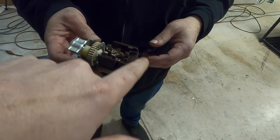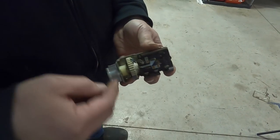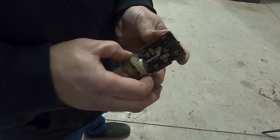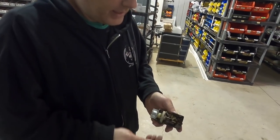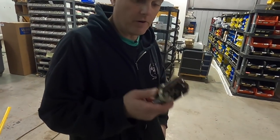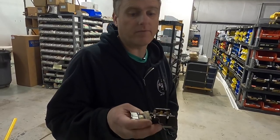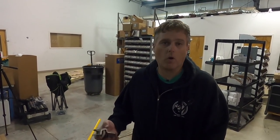Matt pulled the headlight switch out to show what happened. This wire should be coiled around a rheostat that increases or decreases resistance to brighten or dim the instrument cluster lights. When he reached under there, it was already unplugged and hanging loose — they had it unplugged because it kept shorting fuses. The first step is a new headlight switch, and then we diagnose from there. But really, most of what we found is just basic stuff worn out over time — nothing catastrophic. For a driven, modified truck of this age, it's actually in great shape.